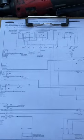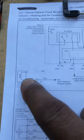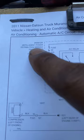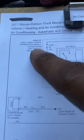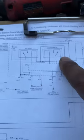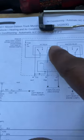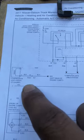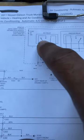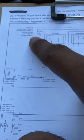Pressure says it should be working, so now I'm going to the electrical side. I like my wiring diagrams — let me grab one and see what's going on. Here we have our wiring diagrams. Here's the compressor right here — it has two wires going to it, one of them going up to the intelligent power distribution module. The AC relay, ignition relay — all that stuff is incorporated into this one component, which I don't like but that's how they did it.